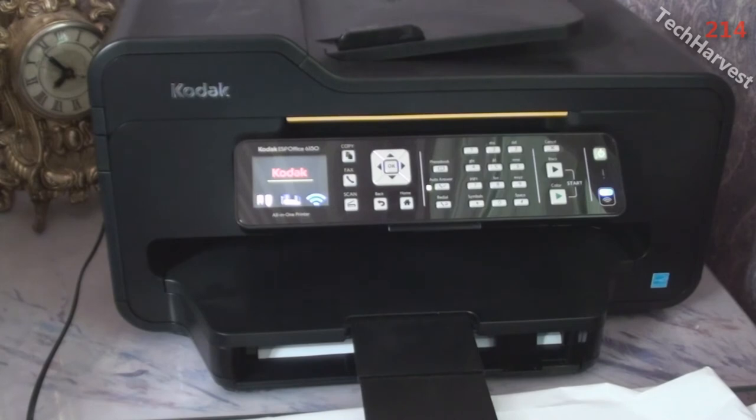I'm up here at my printer and I'm going to try printing from a couple of sources, first being my Motorola Atrix cell phone. What I found just before filming is that it won't work from an app — it won't work from the mail app even though it's a Gmail app and this is Google Cloud Print. But you will be able to print from the web-based email on the phone itself.